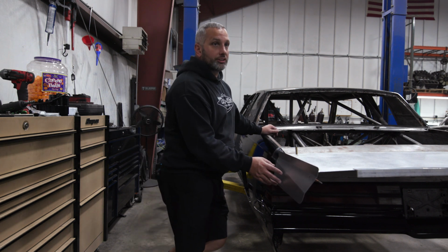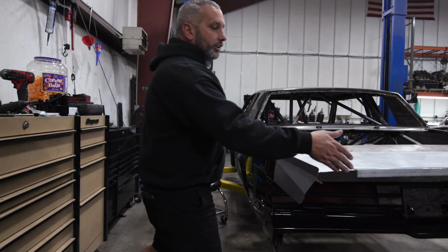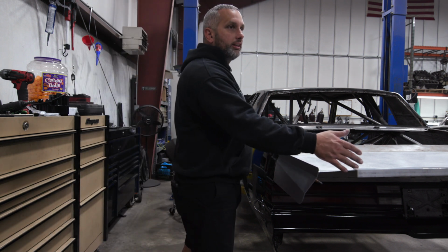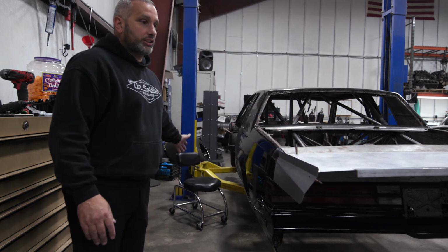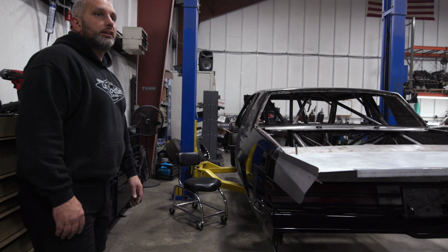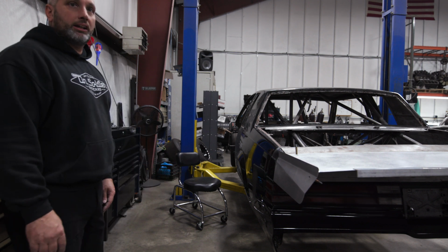The smaller ones, if they think the car's being too wiggly up on the big end, they can either put more downforce on it. If that slows the car down and it still wiggles, you can change that and put the bigger spill plates on it. And that's where the theory of the air cavitating underneath of it and lightening up the back end comes in.